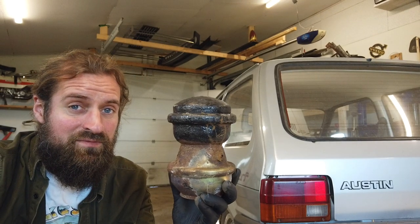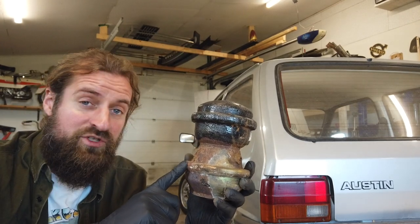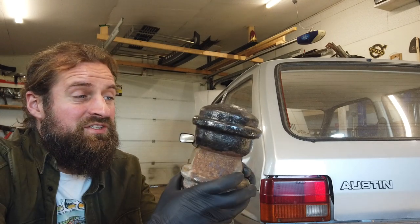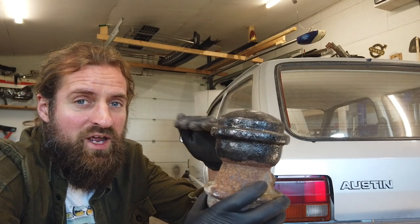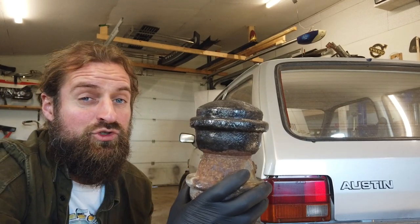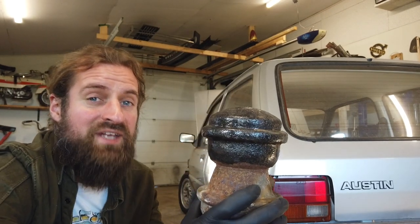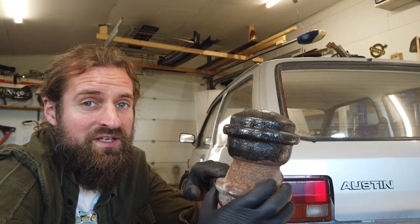Before getting started I'd like to try to explain what I understand about the hydro gas system. This is a hydro gas unit — up here we have some gas, down here we have some hydro liquid, which is what we're going to pump in today. On the old system, up here was not a gas unit, it was a rubber spring. On this system it's more like the Citroën hydraulic systems with a gas and a membrane in between, and that is what gives the car its suspension. The hydro liquid down here defines the ride height and, as far as I know, also the dampening effect. So up here is the spring and down here is the damper.